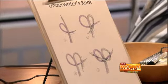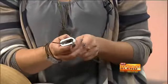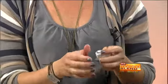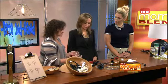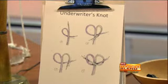Also look up an 'underwriters knot' — it's a knot you tie inside the plug. Plugs come apart, and that knot helps prevent the wiring from being undone if you accidentally yank the plug out of the wall. There are descriptions online for how to do it. For safety, the same hot-and-neutral logic applies to the inside of plugs. There are lots of different styles of plugs — some clamp on, some screw in. To avoid any shock risk, plug into a power surge strip with an on/off switch so you can test it safely.